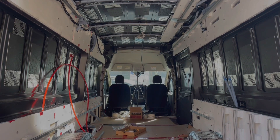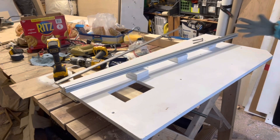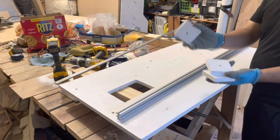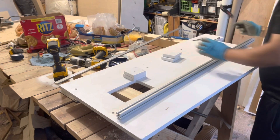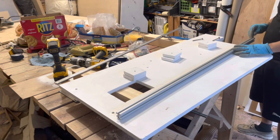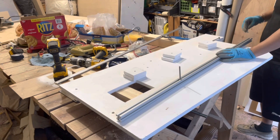The lower section wall is pretty vertical to the floor. I used two layers of 3/4-inch Baltic birch to make some base spacers. Then I will install 80/20 aluminum onto this base. The purpose of this spacer is to raise the 80/20 from the framing to create space for installing insulation between the 80/20 and the frame panel.